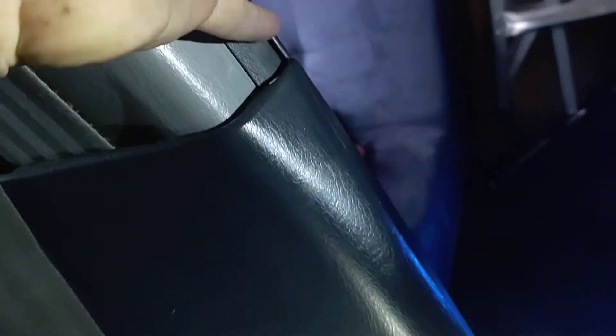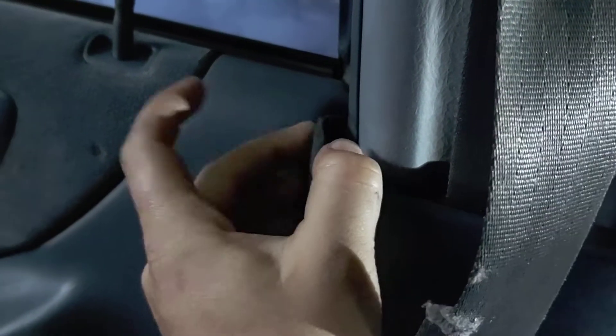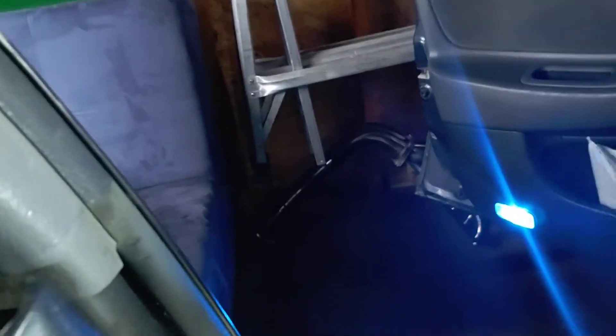It's gonna look more or less like this when you come inside the driver's side door. So over here with the door open you're gonna have a little gap right here between the trim. You want to take a flathead screwdriver or a trim tool, stick it in there, push it a little forward, and it'll bend off of its little hook right there. Then you'll be able to just pull it in and it'll pop free. It may get caught on the back here, but you shouldn't need to open the door — you should just be able to bend it around and pop it off. This whole piece comes off.